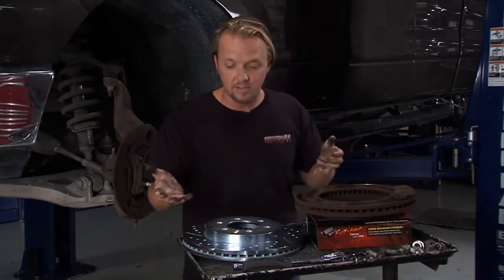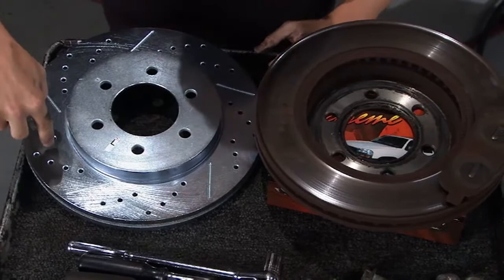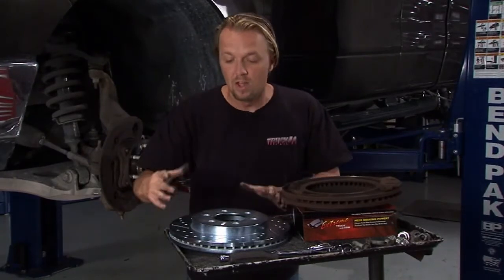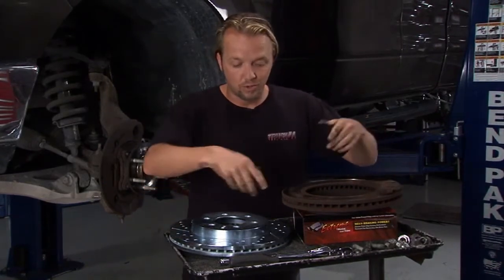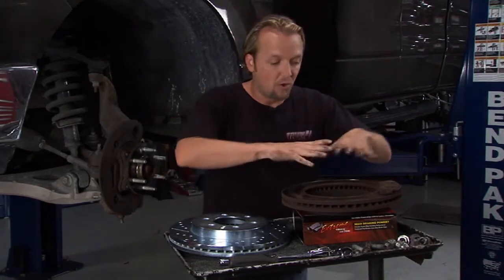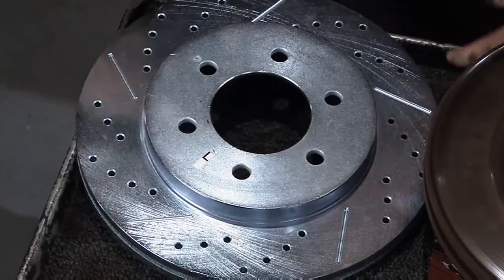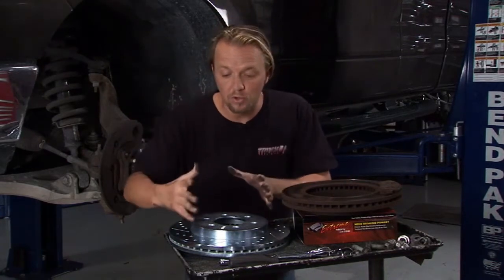If you take a look at these side by side, you see a big difference — these are drilled and slotted. The name of the game is you want to keep these things as cool as possible, and that's what these holes are going to do. Just these little holes are going to keep this rotor up to 150 degrees cooler, and that is pretty substantial. Now looking at the slots — all this material being built up and torn away as the brakes heat and cool has got to get out of there somehow, and that's what these slots are for. All the trapped gases and materials can go shooting out the side, keeping that contact patch between the pad and the rotor as clean as possible. That'll keep things as cool as possible and help eliminate brake pulsation and brake fade as well.